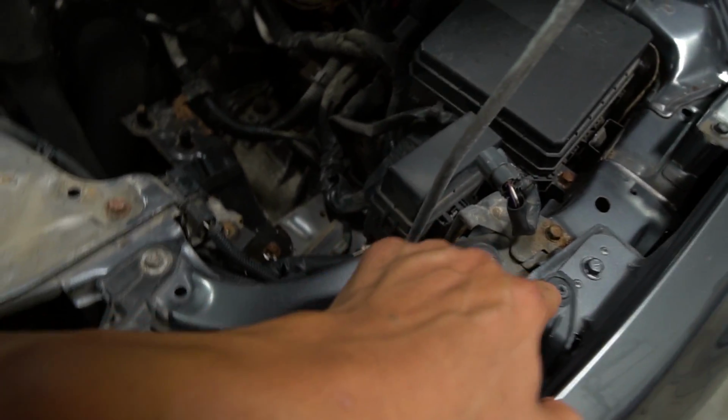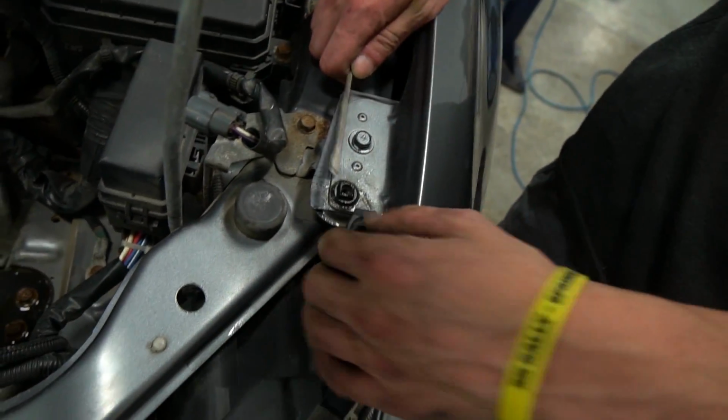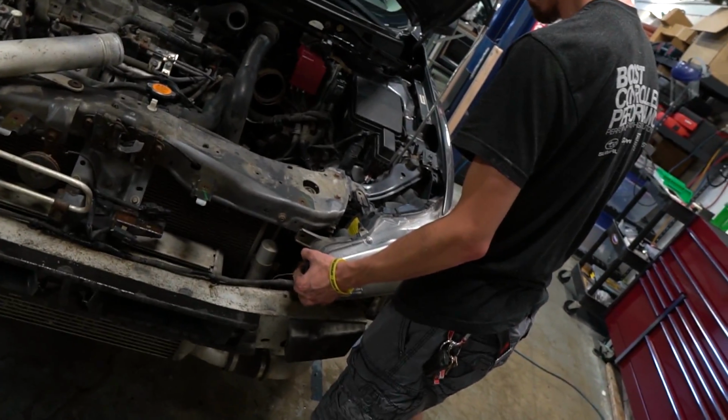In case you didn't check out the last video where I pulled off the bumper and headlight off the Ep.4, I'm just gonna go ahead and put that here so you know how to do that. Got one bolt here, one bolt here, one bolt here, and there's one more bolt down here. Pop it off. It's hard to get with your fingers. Use a screwdriver, give it a little bit of force, pops it right out. Man, all these little tips and tricks.